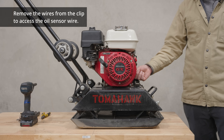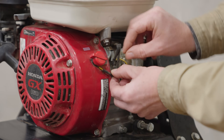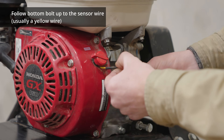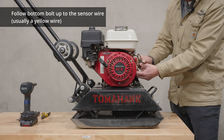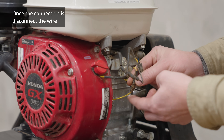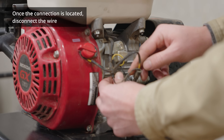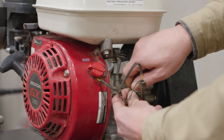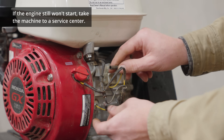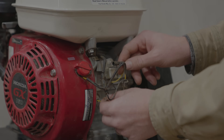To do that, it's pretty simple. You're going to follow your on-off switch, and there's going to be wires in here and a clip. You're going to see a couple of wires, but the most important is that you follow that bottom bolt up — and usually it's a yellow wire — so you can just follow it up, go to your first connection, and pull that wire. And that's it. All I did was disconnect the low oil switch. You don't want to pull this one, so if it goes to your red switch, leave that alone. You're just trying to disconnect the low oil sensor.